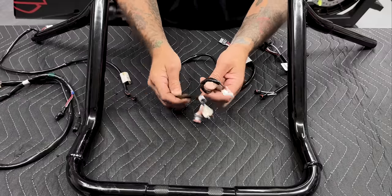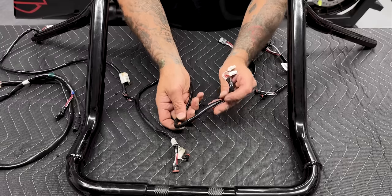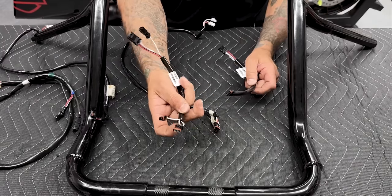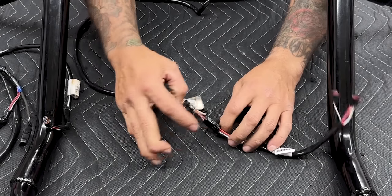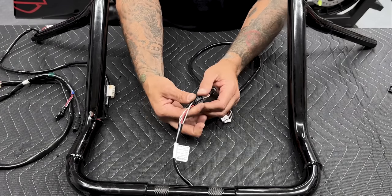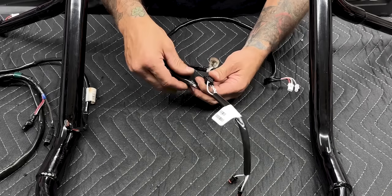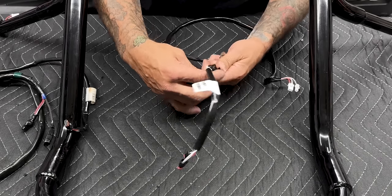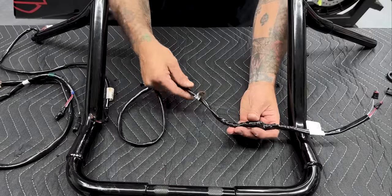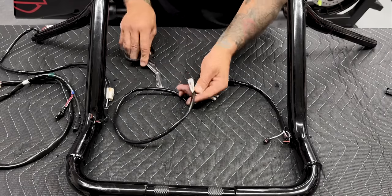Here you have your stock wiring harness with connectors for your run/stop switch and control harness — you want this running up towards the grip. Here you have your run/stop switch with wiring harness. Push them in until you hear it click. When taping them up, offset them rather than bundling them together — that way you have a smaller bundle that gets through the bar a lot easier. Remove the tags to reduce the chance of snagging, and clean it up with brake cleaner. Put just a little bit of lube — you don't need a lot.